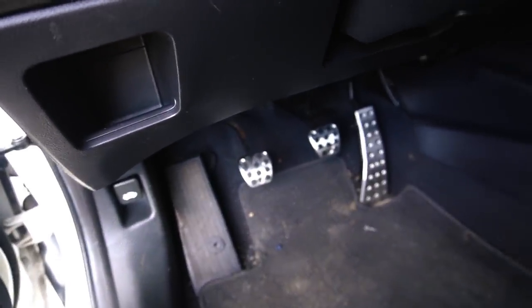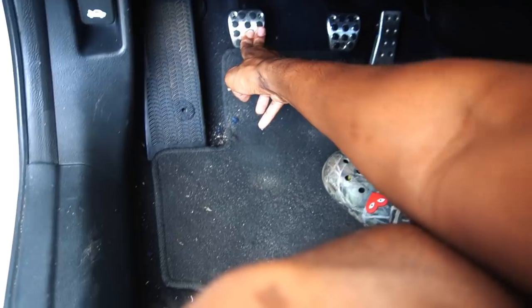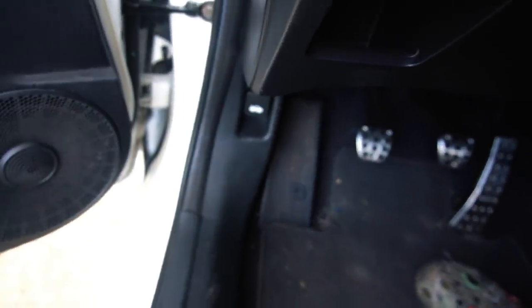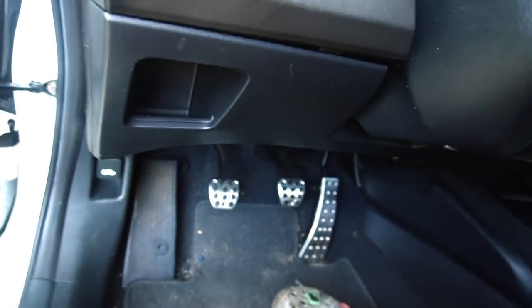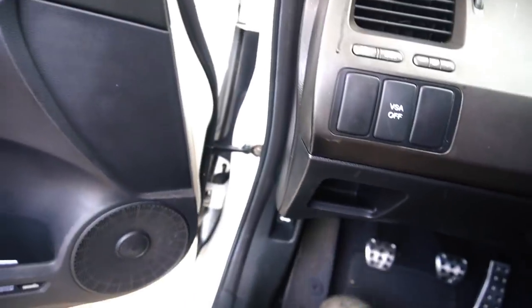And I think I'm gonna go ahead and adjust my clutch pedal as well. I got used to it by now, but I probably want it to catch a little bit more down. I don't like when my clutch catches high, and what I mean by high is when you barely tap it and it engages. I like when my clutch engages towards the bottom. I know if you go too much towards the bottom, it'll damage your gears, pressure plate, and wear out the clutch. So I'm not gonna go too low with it, just adjust it a little bit. I'm probably gonna do a clutch bypass too, so I can just start the car without having to press the clutch in. So I got some things to do today to have fun with the car.